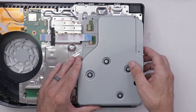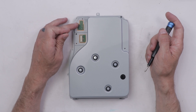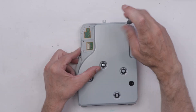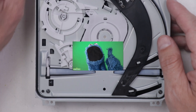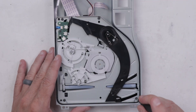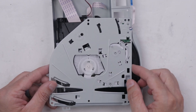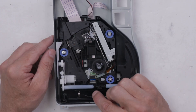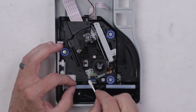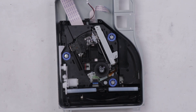We just need to disconnect it from here, and then the disk drive just lifts right off. I also want to make sure that the disk drive is working correctly, because there's no point in doing all this work to fix the connector if the disk drive itself is broken. I see some cookie remnants right here. Let's remove this board first, and then I'm going to remove this bottom metal plate from the disk drive. Everything looks good on the metal plate itself — I don't see any problems there. And other than a few crumbs on this roller, I don't see any problems inside the drive either. So I'm going to give this roller a bit of a cleaning. Now we're going to put this back together and get to the hard part.